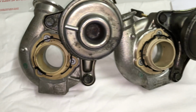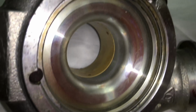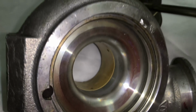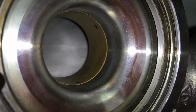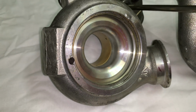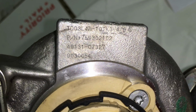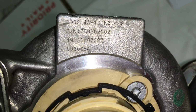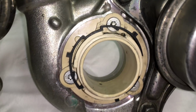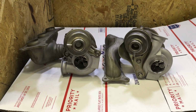which may make it complicated for you to try and install a regular silicone coupler on the intake with it in the car. I don't really know, but I know that I can upgrade these turbos if I had to, but I don't know how easy it would be to install it on the car. The billet compressor wheel is larger than the plastic inlet, so if I machine this compressor housing, then there won't be any plastic inlet anymore.